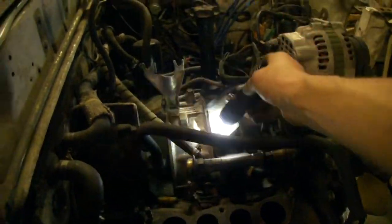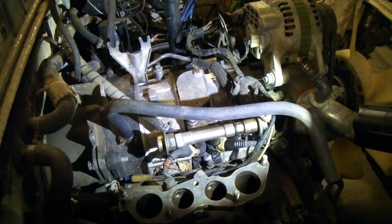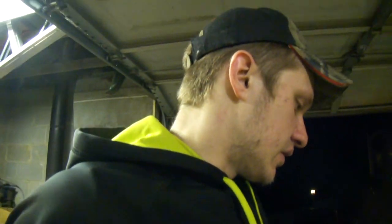Got to block off the EGR valve — there's exhaust gas that comes up through here too. Got to block that guy off. There are plenty of places you can get block off kits, whether it be LRB Speed, Atkins Rotary, Rotary Aviation — there's a lot of places that sell block off plate kits for these motors. So quick rundown: rip your rat's nest out, rerun your fuel lines or use the hard line. Block off pretty much everything on the upper intake manifold plates. You need to keep the TPS plug, your intake air temperature sensor plug, and your mass air flow sensor plug — that big thing by the air filter. Otherwise you can take everything else off. Thanks for watching. Keep your rat.